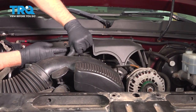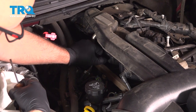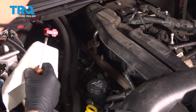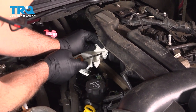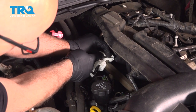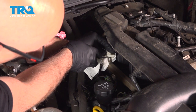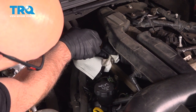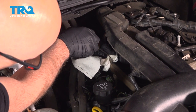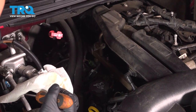Pull this cover off and slide it out. On the fuel line there's a cap — I'm gonna remove that cap. I wanna bleed off the pressure in the fuel system. Take that cap off and then take a rag. There's a little Schrader valve right there. Just take a straight blade screwdriver or a pick and push down on the Schrader valve. Be careful — you wanna wear safety glasses and gloves. All the pressure's bled off, so I can put the cap back on.